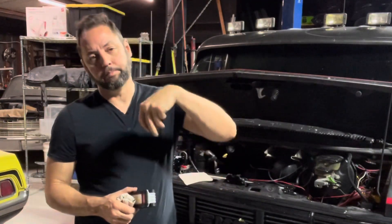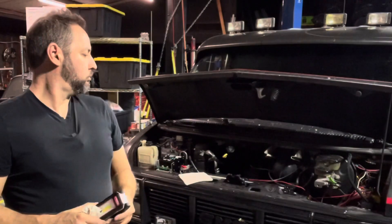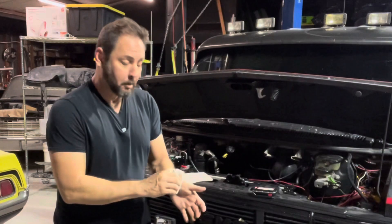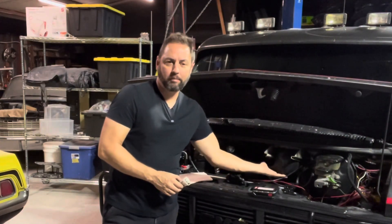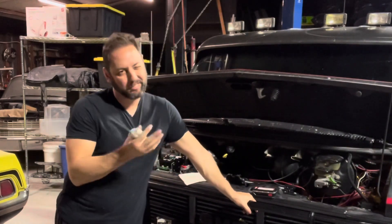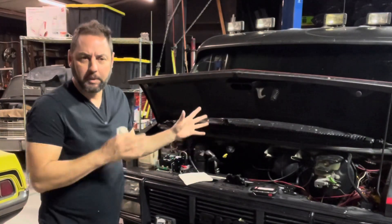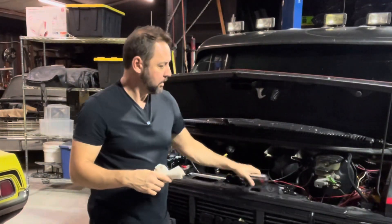We're going to check the rear end magnetic dipstick again and see how much more metal is collected on that, if any. Let's go ahead and check the tire pressure because we're going to drive this thing across town tomorrow. Let's make sure it doesn't pull left or right due to tire pressure. Right now the alignment feels great — it drives good. This is a vacuum reservoir — it's not cutting it. This cam causes the engine to have a little bit less vacuum, so the brakes are a little hard sometimes. We're going to try to keep the vacuum in a reservoir with a vacuum reservoir.